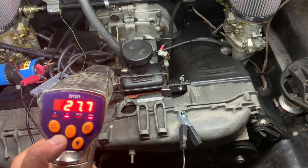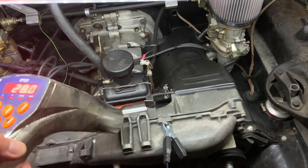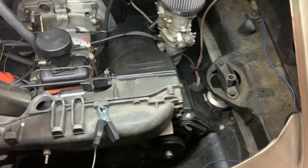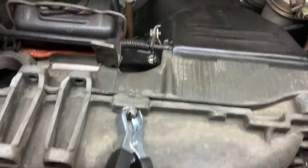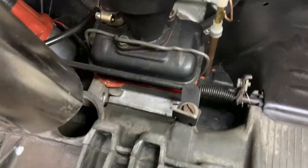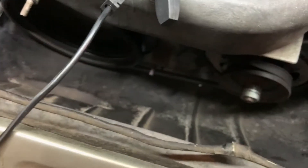As you can see, that flashing strobe light shooting down the hole — that's how you're going to find the line on the spinning fan, and it's going to line up with that V-notch. That will tell you when you're on the money. Right now it's been timed for just top dead center.